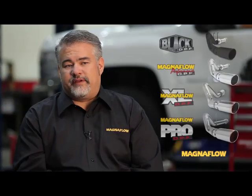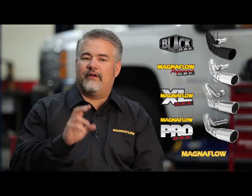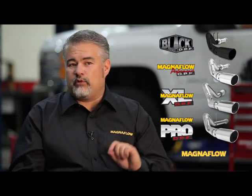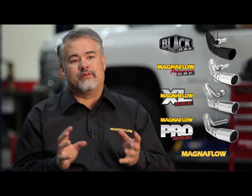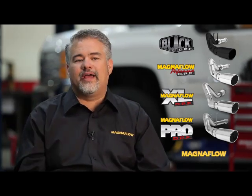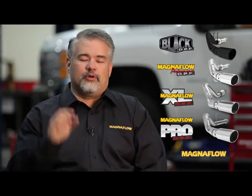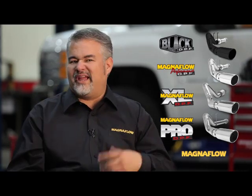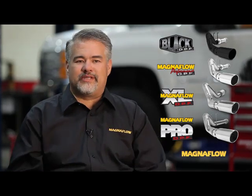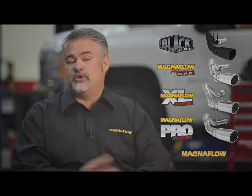MagnaFlow's DPF kits are different than most that you'll find in the industry. One of the key elements is that we have a tip on every system, whether you're buying our MagnaFlow Black Series, where you get a black-coated tip, down to our Pro Series. The tip's an integral part of how we make the DPF system work. We have an intercooler device that allows us to cool the system down when it's in regeneration. Apart from that, though, we also have a muffler. When you're buying our top-end systems, we give you the muffler for that guy who wants to tow, at the same time a delete pipe even to remove it for the guy who wants a little more sound. This is a unique part because a lot of the competition has gone out there and provided systems that have no muffler at all.